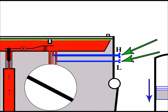and the L means low, for the engine's low speed adjustments. Now, I have got videos on this channel explaining how to adjust the high and low screw and how they are used to tune in the engine itself. So I won't go back into that in too much detail now, because that's a video in itself. Instead, I'll keep it to how these screws can relate to bogging down of the engine.